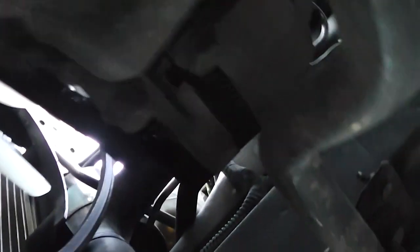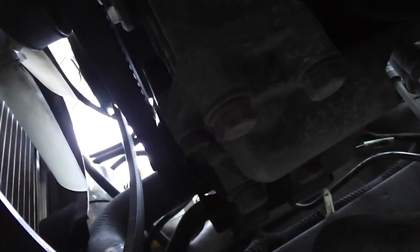I'm now underneath the front of the engine. I got the splash pan removed so you can see. This is the oil pump — it sits right above the sway bar on the passenger side front of the engine, underneath the alternator. There are four 12-millimeter bolts securing it to the block. I'll be removing those, and then we'll take the shaft out.